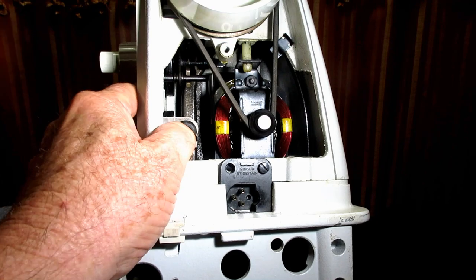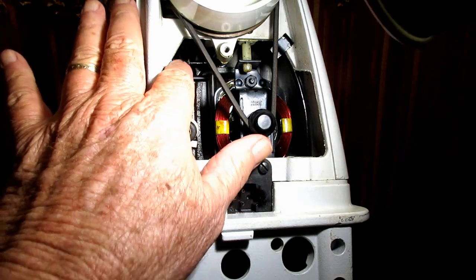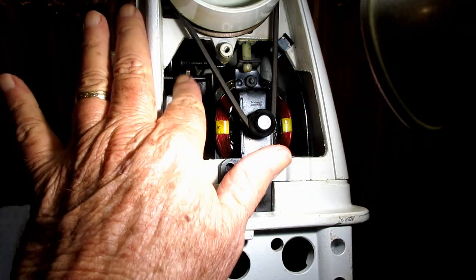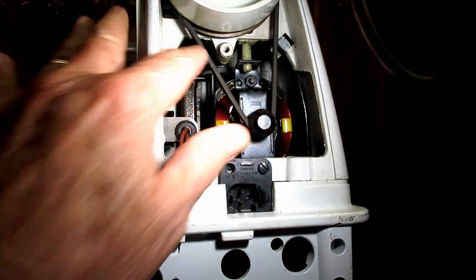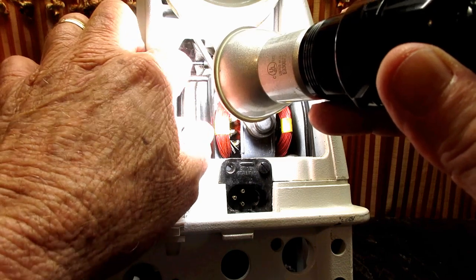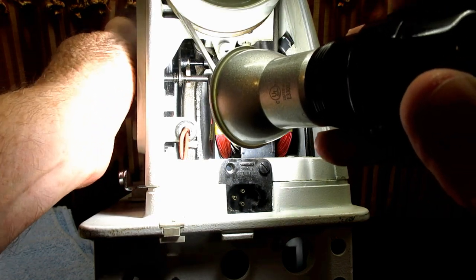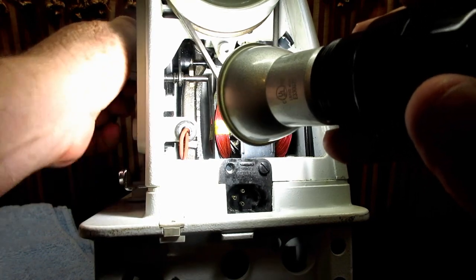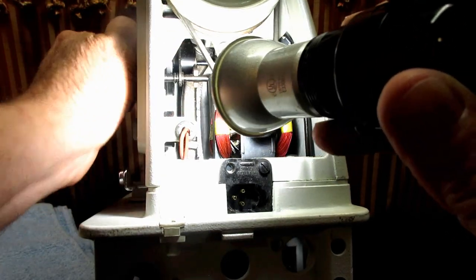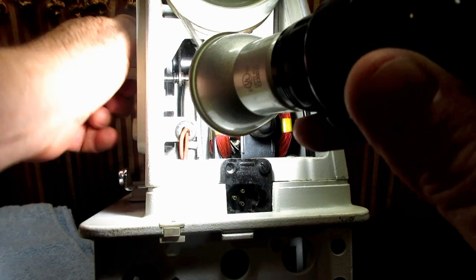He told me there's a couple of places here that he puts a little bit of grease. One, it's going to be very hard to show you, but if you look at this, you'll see a kind of teardrop shaped bracket that comes off of this post, around this post, and goes up around a second post in there. Okay? And that up at the inside there has a hole in it that, when you turn your stitch length, takes that center cylinder twist in and out of that hole in this teardrop thing. And that's one place he greases, the outside of that cylinder.